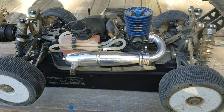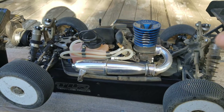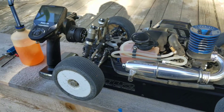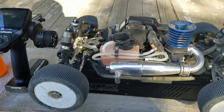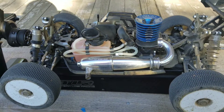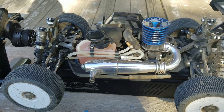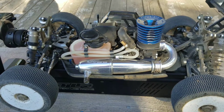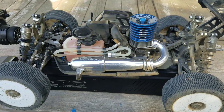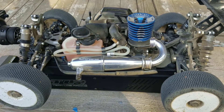It came down on power a little bit on the bottom, but the top end really benefited from it, and the temperatures are drastically different — this thing doesn't even really get hot anymore. The idle is more consistent from the standpoint of coming off the throttle, when it clears out all the way when you hold it wide open down a straightaway. Just a little sacrifice in performance but way better drivability and temperature control.